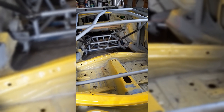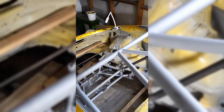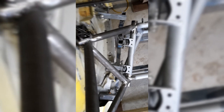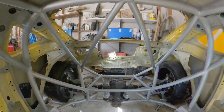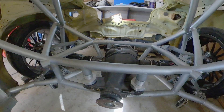Once that happened, I built the frame to the point that it could be bolted into the original frame rails — higher position than standard, all the pivot points moved up in the car. Then it was a matter of joining the roll cage tubes from the main hoop down to the rear cradle, which basically locked everything into position. Then I was able to cut out the original frame rails and add more tubes until I got to the final structure you can see here.